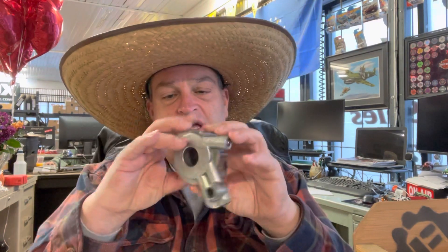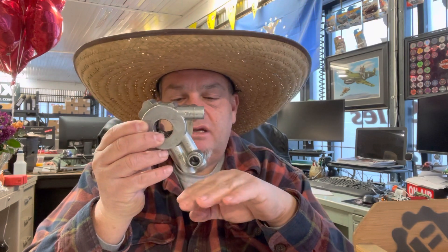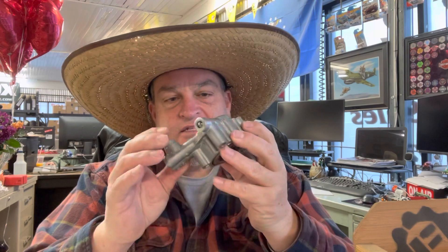The orientation of this pump — when it's on the back of the plate, this goes into the motor. There's no ring there, and this sits about a quarter of an inch off the bottom of the cam case at the very bottom. This is what picks up the oil and sucks it back into the engine. The pump acts as both a pump and a scavenging gear — it sucks the oil out of the engine and puts it back into the tank. It's very, very important that you get your cam chain tensioners inspected if you have a Harley from 1999 to 2006.